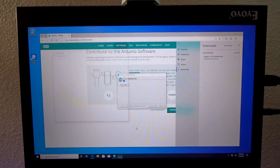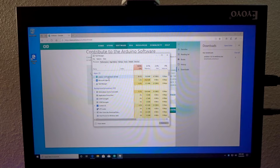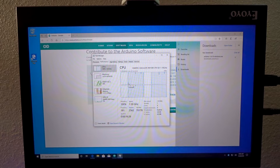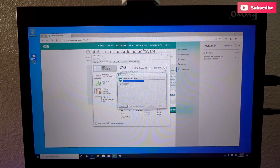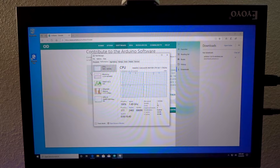Let's take a look at Task Manager to get an idea of what's going on. Our CPU is pretty pegged out. Going over to the performance tab — yep, it is pegged out. We are using quite a bit of processing power to install this program and probably run updates. We can see we're at a turbo boost of 1.5 gigahertz with a base clock of 1.1. We've got one socket, four cores, four processors — so no hyper-threading on this one. We've been up for about 17 minutes.